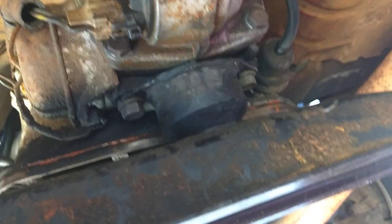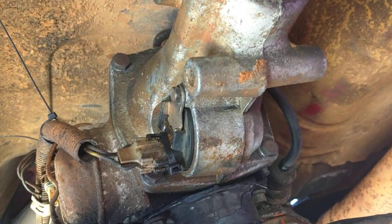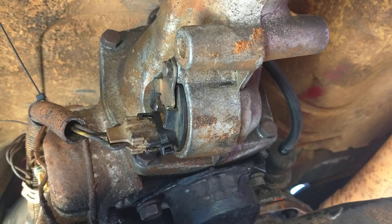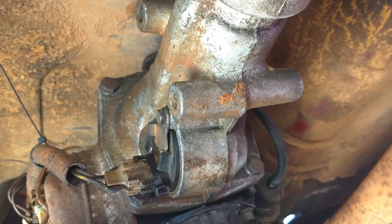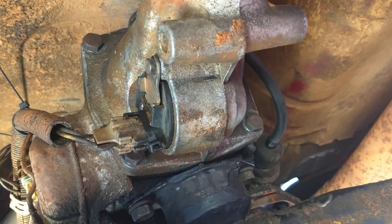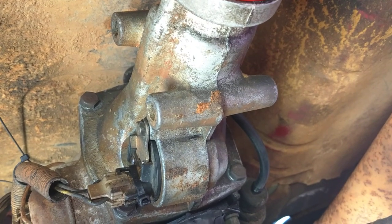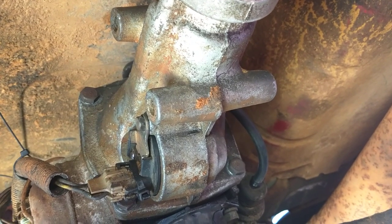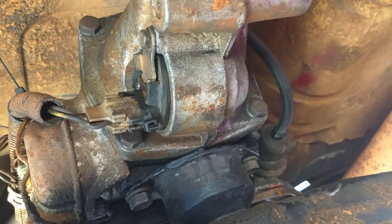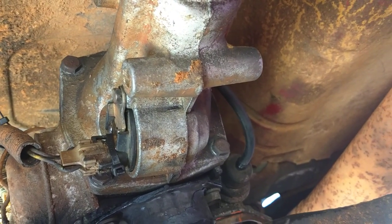You just take the driveshaft down with those four bolts back there, then unplug that sensor — which is going to be another challenge: finding a 350 Turbo tail housing that actually has that electronic sensor. I thought I saw one on eBay listed for a 350 Turbo, but I've got to do some measuring. I want the speedometer to work, but for safety reasons, if I have to replace it with the original 350 Turbo housing just to be safe and have no speedometer, I can get a phone app to track my speed. You just undo those four bolts on the housing — there's an O-ring in there — and it's really easy to swap out.